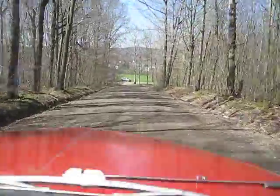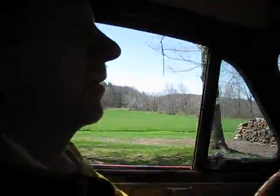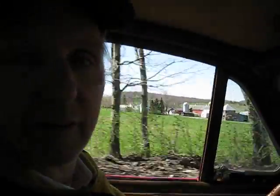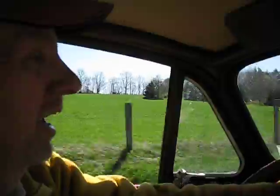We're heading down the road. Brakes are working better than they did — I got these special brake pads from Porterfield Racing Company in California. They make brake pads for old vintage cars because the old vintage cars had asbestos — a softer compound that worked well but gave everybody cancer. Nowadays they've changed all the pads, and the newer pad materials don't work as well in a vintage system. These guys are making them out of a compound that works pretty good — a soft compound where the brake pad will wear and not the metal.